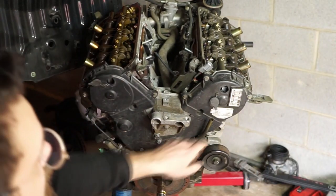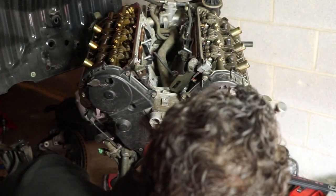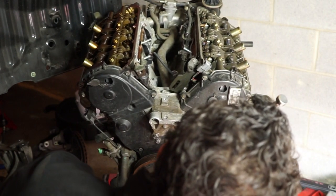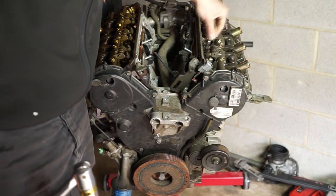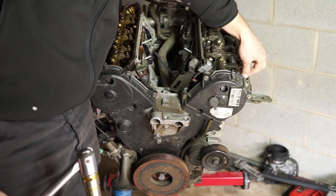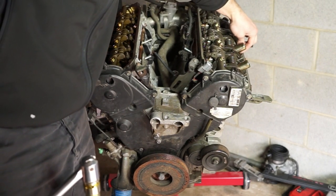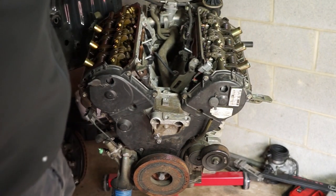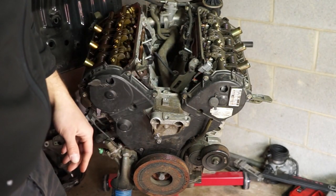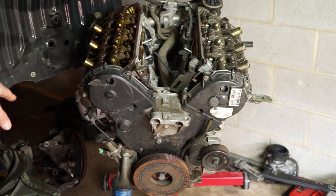My next one after number one is four. When you look in there, you'll have a timing mark and then there'll be a number — let's line that up a little bit tighter. Now that I'm on cylinder number four: one, two, three, four. You'll know you're on the right cylinder because the valve tappets will be loose to touch. On the next cylinder they'll be tight as a rock. As you adjust one, you just go to the next, rotating it over and adjusting whatever cylinder you end up on. I'm going to rotate back to cylinder number one to show you how to actually adjust the valve itself.